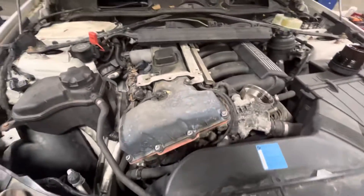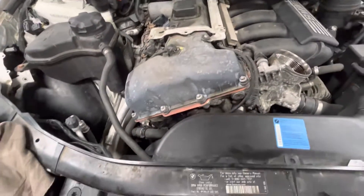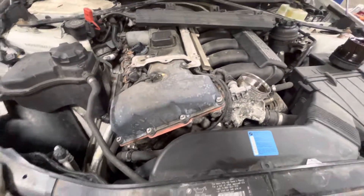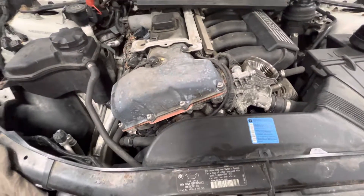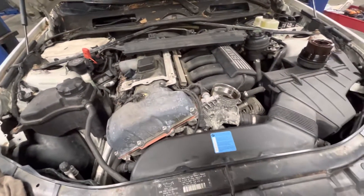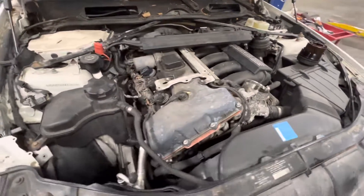The solenoid is a pretty easy fix. It's really the only thing you're going to do externally on the motor that can influence the problem and that you can do on the floor easily. So it's kind of your only shot unless you get pretty serious. That's where I would start if I had variable valve timing faults on one of these motors. Thanks for watching.